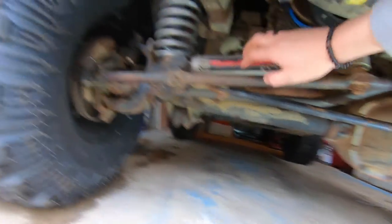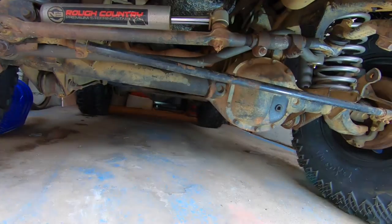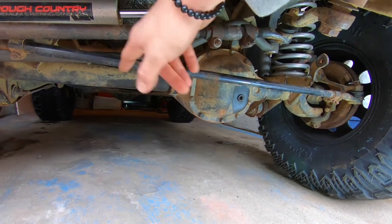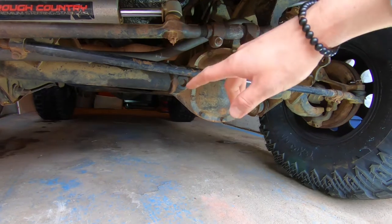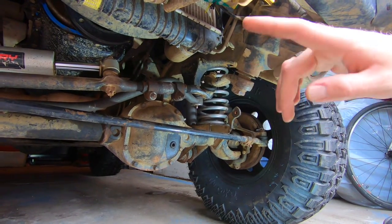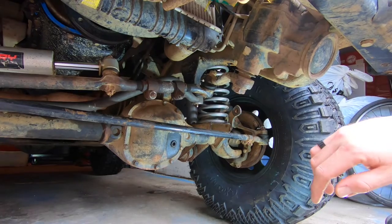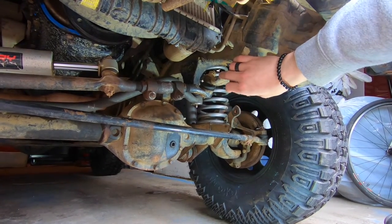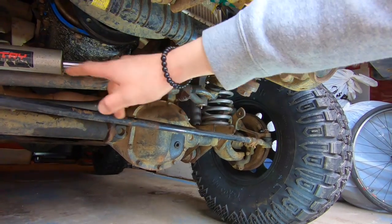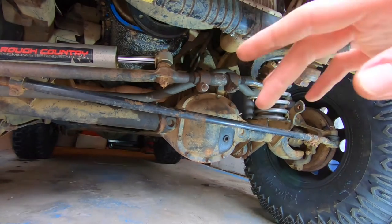If you're looking at upgrading anything in the steering system, you can change anything separately — steering stabilizer, drag link, tie rod — everything comes separate. However, I'd recommend getting a full drag link and tie rod assembly together. If you're replacing one, chances are the next weakest link will be the other piece and that'll go next. Also, a drop bracket or drop pitman arm — which gives you an inch lower drop — would help, because after a lift that angle becomes more severe and causes issues.